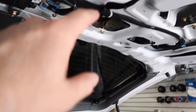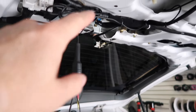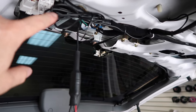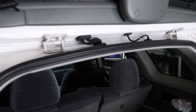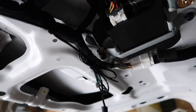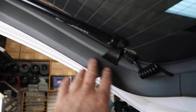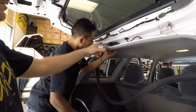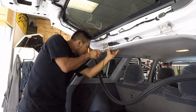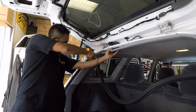You want to keep this connection point located somewhere near the camera. Even though it comes with about six feet of wire, keep the connector in the rear — because you need it to be serviceable. If the camera goes bad, you don't want the connector buried deep inside the car where you'd have to pull everything out. Up here is a factory ground point, so we're going to ground our camera there. We'll zip tie the camera wire along here, removing panels as needed, and bring it through this grommet. Running the wire through the rubber boot can be a bit of a challenge, especially with this style that has a big RCA on it — it will go through but it won't be easy.